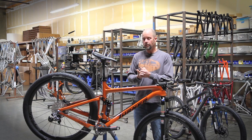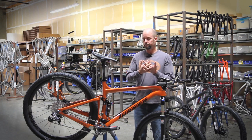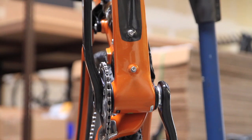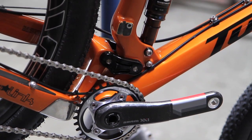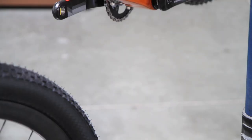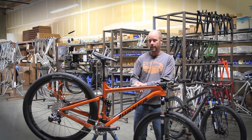The engineers at the factory — we went through different ride samples. Both the front and rear end can be tuned separately, and you can tune for torsion as well as lateral stiffness. We got a nice stiff bottom bracket — the down tube goes to pretty much full width, 73 millimeters at the bottom bracket, and the seat tube is quite wide as well, not a full 73 of course because the DW Link needs to fit in there. This bike, as you can see, is front derailleur compatible with direct mount.